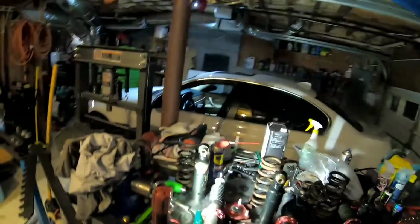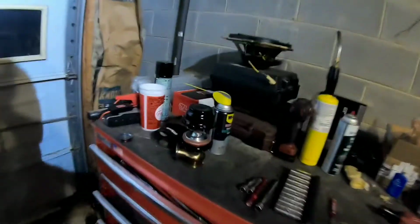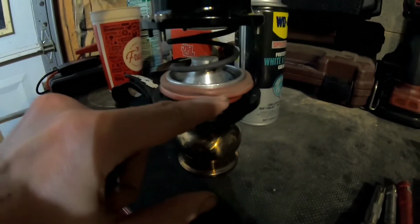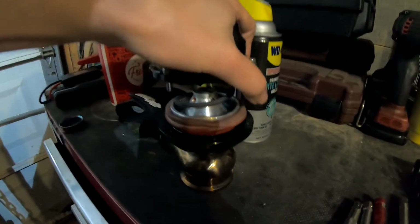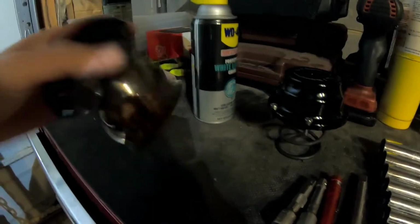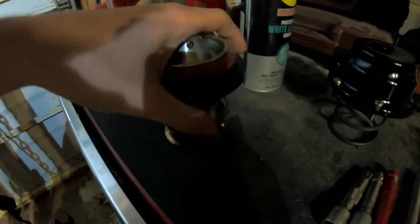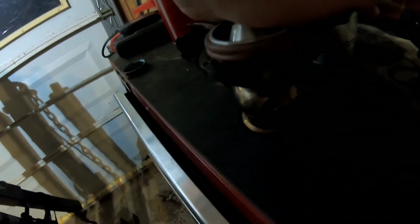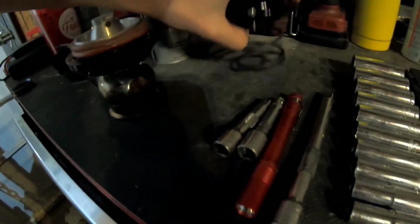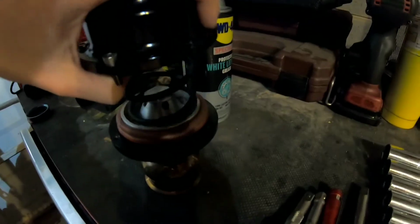And we put a new wastegate on the BMW. The old one lost a piece of hardware somehow, and it started trying to push the diaphragm out, and now the actual valve in there is pretty seized up. And this is the bigger spring that they offer. I think it's a 13-pound.